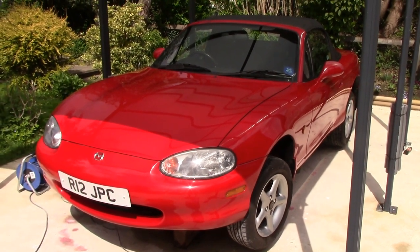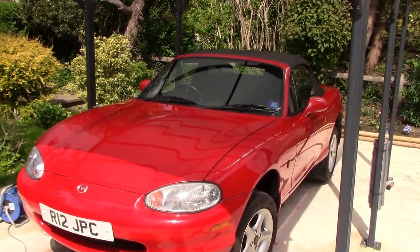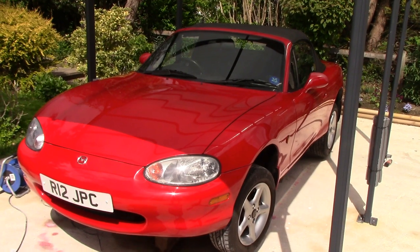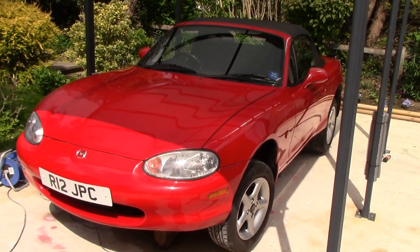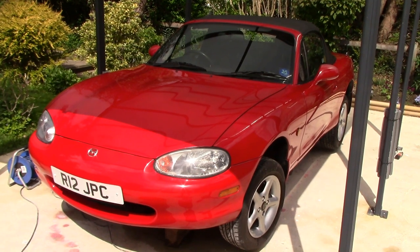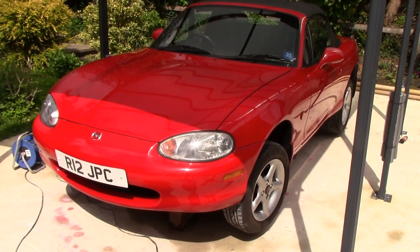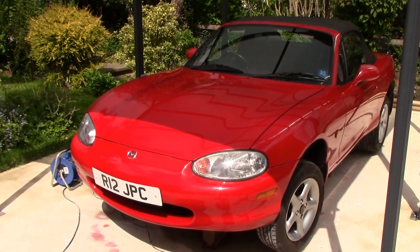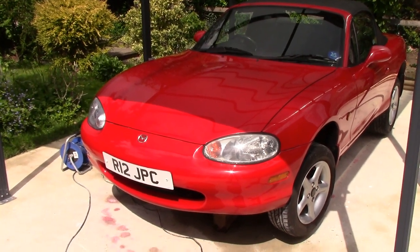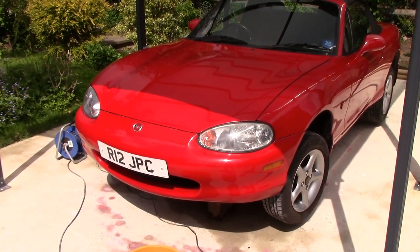I'm going to drop it down, torque the bolts up, just got to unblock the drains for the roof, but I'll do that another day. Otherwise, valued viewers, that is project finish — chuffed with that. So to recap: we had it come in crashed and damaged underneath. We did the sills on either side, the arches on either side at the rear, cleared up the whole arch well and underneath the car. We painted it, cleared up the front arches, painted it, cleared up all the pipes around the engine bay and all underneath. Simplified the engine bay, moved stuff about, jigged the panels at the front so they fit now. Repaired the door, got it legal — and that's it. We'll go and hopefully enjoy it somewhere. I hope you enjoyed it and see you later.